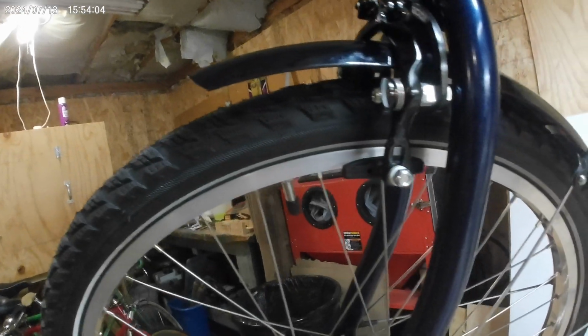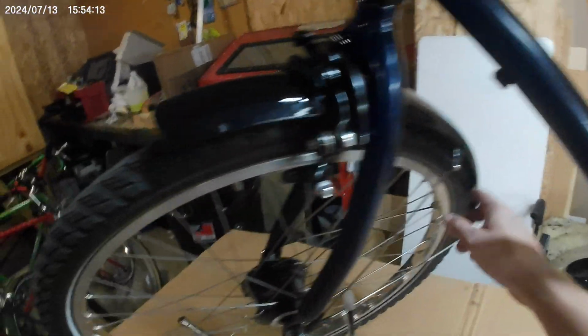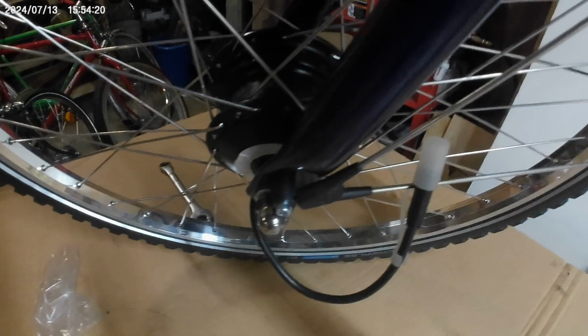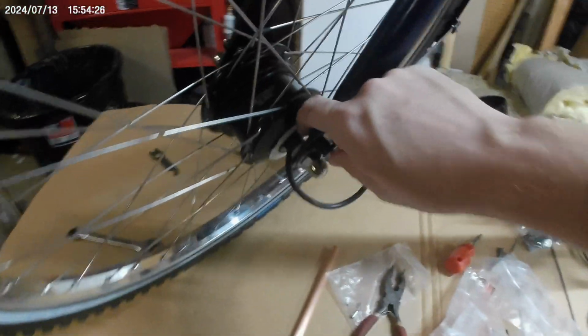Unfortunately, that's as far down as the front will go, but I was able to tighten it up at the back, which is the important part, because if something gets sucked up back here, it'll get kicked out instead of binding up. Had to use two spacers to get sufficient clearance here around this fork, but that's fine, that's what they're there for. And it made my bolts the correct length, so they're not going to interfere with anything. And everything's looking pretty peachy up here.